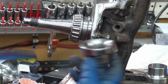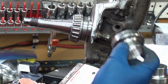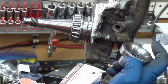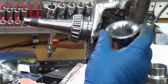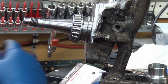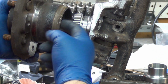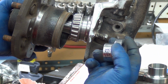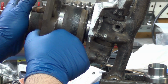Because what I do with the 621s right now is I make a few 620s at the time, but I primarily make 521s because I can always throw these into the manual lathe and take 80 thousandths off. They end up with a chamfer instead of a fillet, but they still work exactly the same. So if I can just take a little bit more off and make it work with the Toyota hub on Kingpins, with that seal that is used for the hard bodies, because like I mentioned, this large OD is the same as the hard body seal, that would work out nicely.